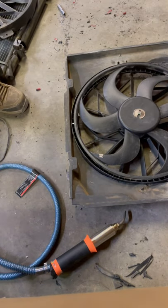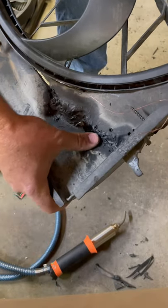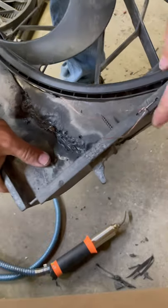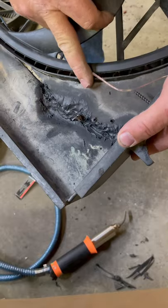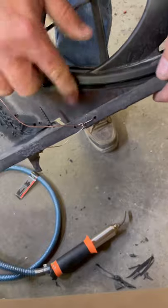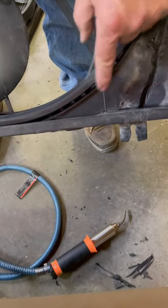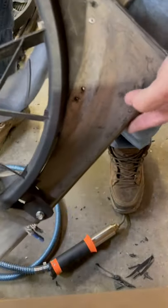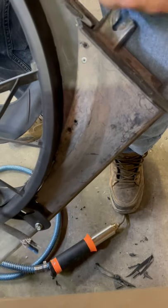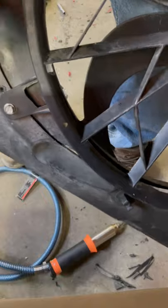You know, that's smoothed out a little bit better but you ain't gonna see that from sitting inside the car or when you raise the hood because it's gonna be up against the radiator. I took the screws out — this is a new weld job, first time using it, first time ever plastic welding. That thing's pretty tough. Just this — I took the screws out, the only thing holding them was the screws, and this thing's pretty tough. This right here is held in by that weld and it ain't going nowhere.